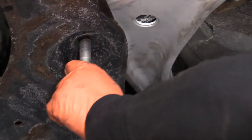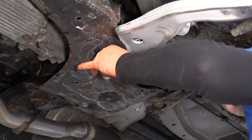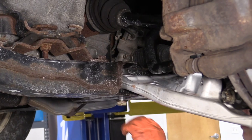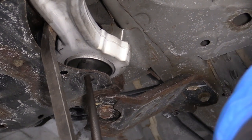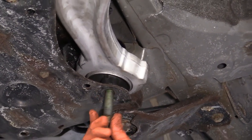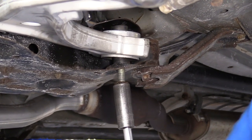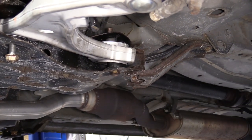I'm going to take a dowel tool and line up that bushing. Now I can put the bolt through once I get it lined up. I know the top of the bushing has to go inward just a hair. I'm going to try to line the back bolt up — maybe I can get the front to go in easier if the back's in first. I'll use a socket extension and try to straighten that out, then hammer it up. Put that nut on and do the same to the front.